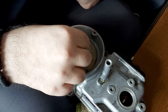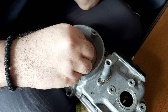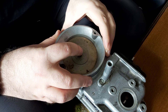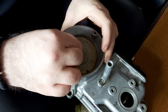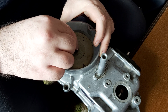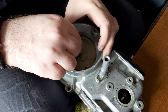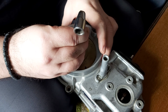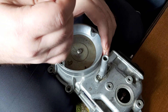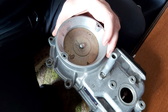You will have to be very gentle and patient in order to succeed. You must do this job very slowly — align the plate and its weight, then turn the screw in, making tiny movements. Then deflect the plate to see if it rubs the edges or not, and repeat. Once you're done, tighten the screw carefully with the spanner and mount the airflow meter back on your car.